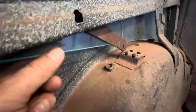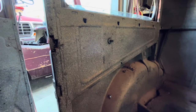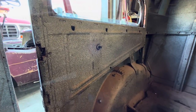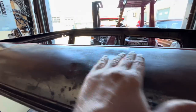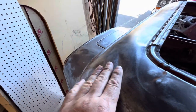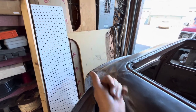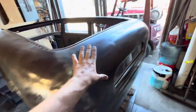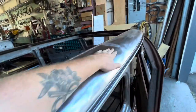I think it cracked because there's no window track on this side — the glass is just sitting right on the arm here on the little wheel, so we probably just put too much pressure on it. Again, this is why when I got this car a year ago, we blew it completely apart — there was so much stuff on it that wasn't done properly. I just took that piece of glass right out. I think we're going to spend the rest of our time fixing these little dents on the roof. We've got one there, a high spot here and a low spot here, a little dent here — you can't actually get on the backside of that, so we might have to get in there with a little bar and bump it up.